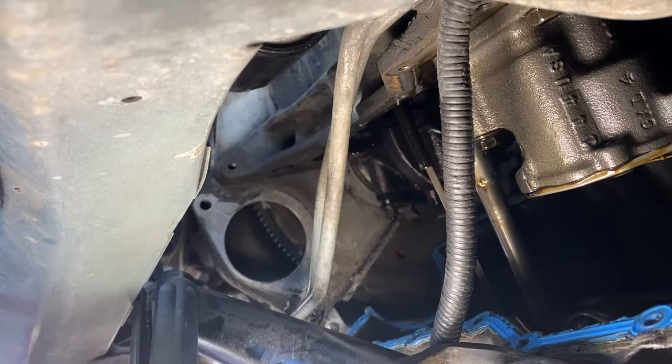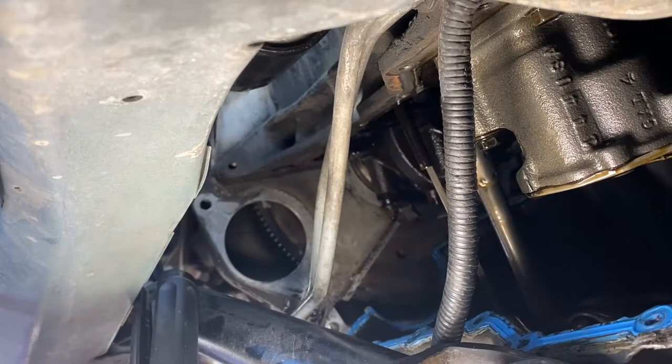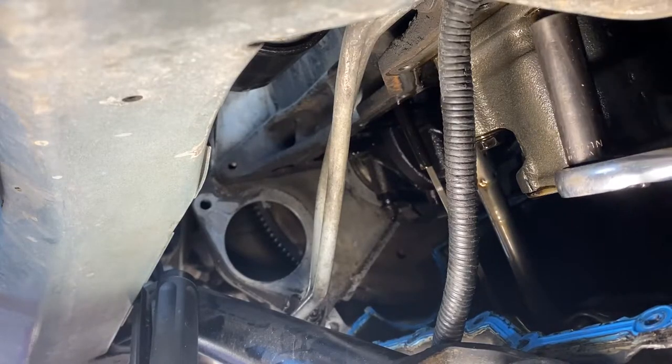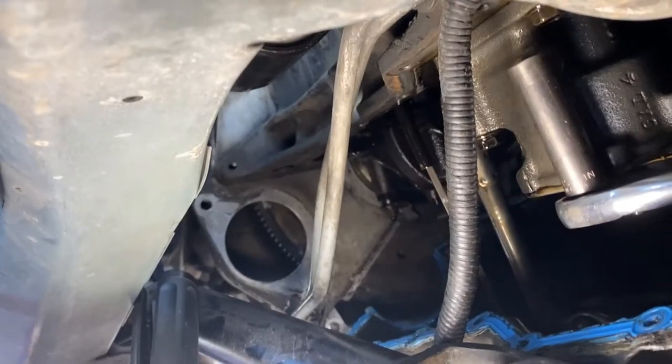All right, we're on the home stretch. Now, this is probably one of the most irritating portions to do when removing the oil pump and the pan. So you have two bolts. One up here that's a half inch, and you have the other one back here. Trick, unless your Jeep is lifted, is you're gonna have to take this pump loose, drop it in.